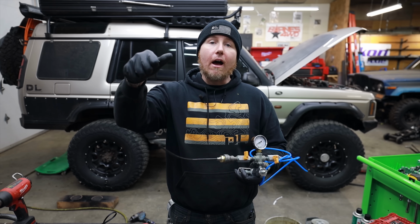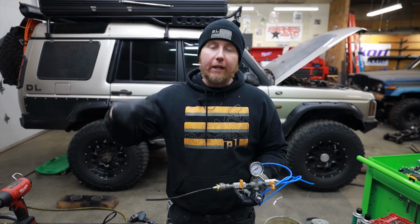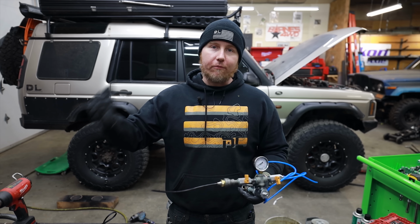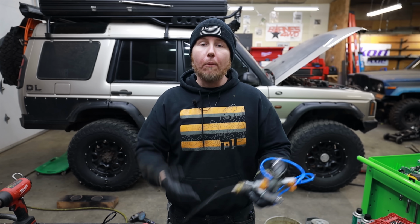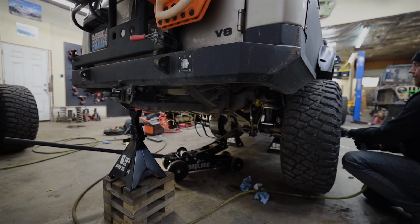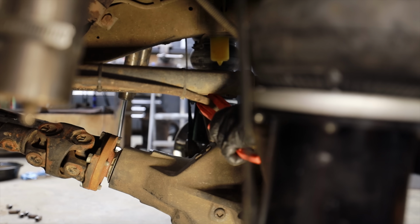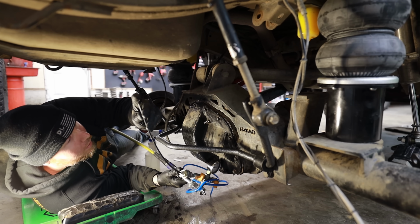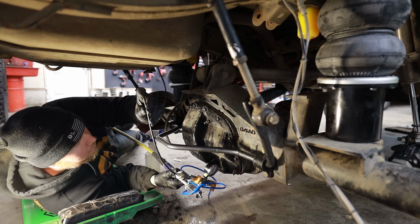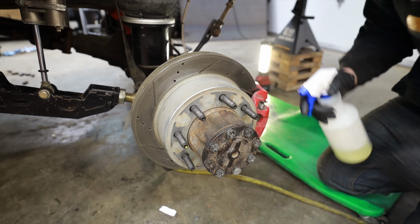We're going to pinch off our vent tube, and then I'm just going to add the tiniest amount of pressure, and I'll squirt and test section by section before we finally end at the top of the axle tube, and hopefully I can see and film exactly what's leaking. One really big benefit that this plan has going for it is that I can clamp off the vent tube and really give everything a super good test. So even once we find where the leak is coming from, I want to make sure that there isn't another small leak from somewhere else and this isn't a cumulative problem from a whole bunch of different places.